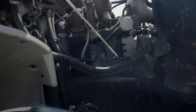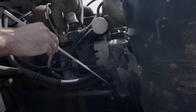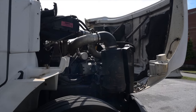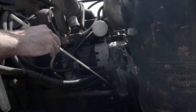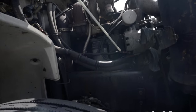Water pump — touch and say: The water pump is securely mounted, not leaking, not cracked, bent, or broken with no missing hardware. It operates properly and is belt driven. Make sure that you touch the belt when talking about it. The belt has no more than three-quarters of an inch of play at the middle point of the belt. The belt is not cracked, frayed, or broken. The hoses are securely mounted, not cracked, worn, or broken. There are no leaks and there is no missing hardware.